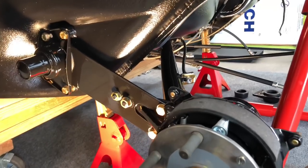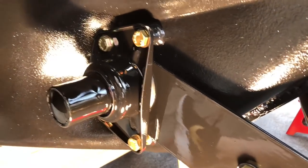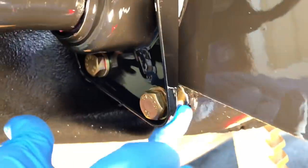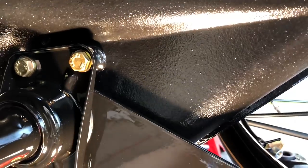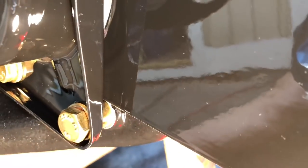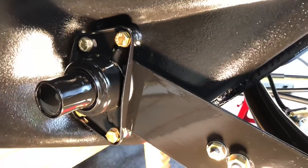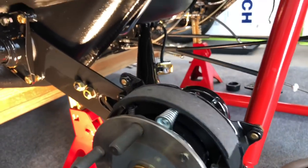So we've got our left side set up. This whole process, about four hours for the one side. Most of it is just sorting out the splines and the angle and how to get everything to move into position without special tooling. The biggest problem I ran into is this lower stud right here. We have to set the angle of our spring plate at 36 degrees, and that's actually going to be dropping down into the area where this stud goes. We've got to put the bolt through it, so we can get the angle off a free swing without that bolt in there.